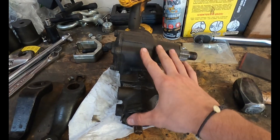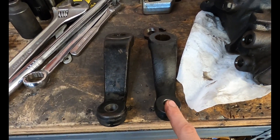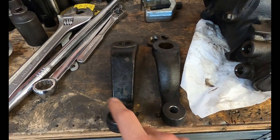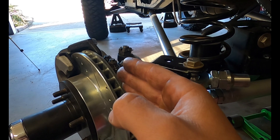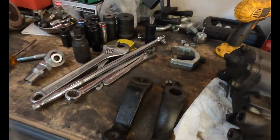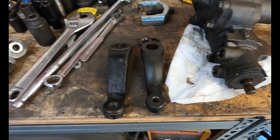The steering box input seal is leaking, so we're going to replace the seals as well — we'll take care of that after the fact. The main thing I want to focus on: this is a stock pitman arm and this is a pitman arm from a Jeep XJ. I want to make it a custom double shear application. Because I need it special for our high-steer steering assist with an 8-inch throw, the end of the pitman arm needs an 8-inch draw to match. The current pitman arm measures right at six and three-quarters of an inch, so we need about another inch and a quarter of travel — we'll have to elongate it, making it a little bit longer.